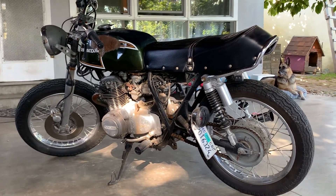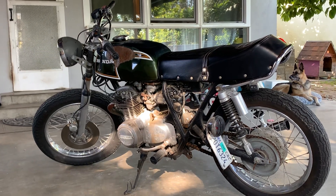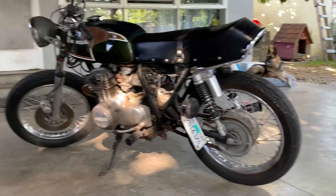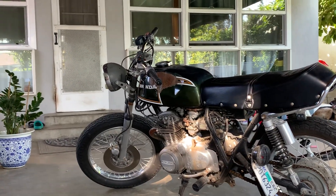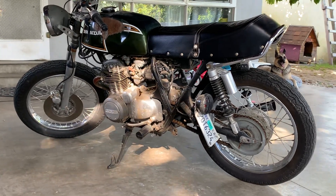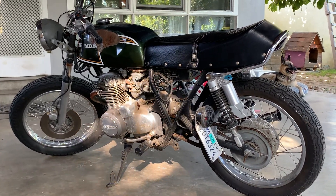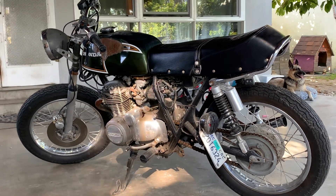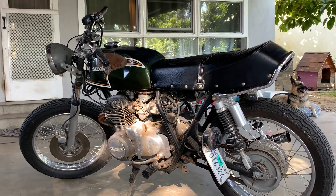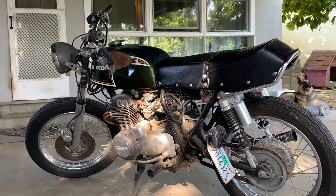My plan is to take this up to San Francisco and ride it across the Bay Bridge and the Golden Gate Bridge. First I'm going to clean the carburetor, get a new battery, two new tires front and back, and replace the tank. Then I'll make sure all the wiring is clean, hook the signals back on, and see if I can find the fenders. If I can't find the fenders that's okay — but I'll at least have the signals, tank, and carb all ready to ride. That's pretty much the story with this bike — it sounds amazing and it's one of my favorites.